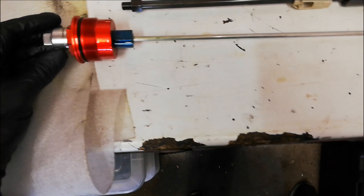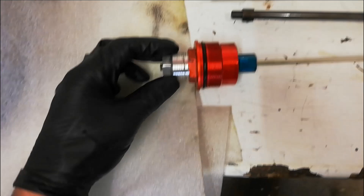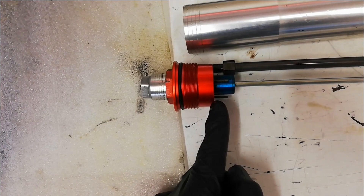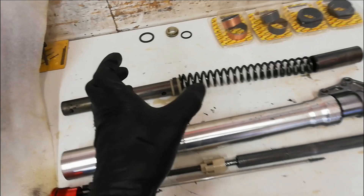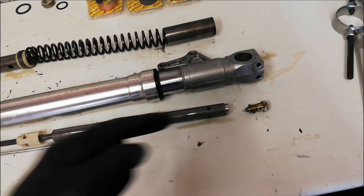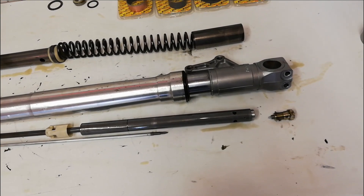These cartridges are actually peened together, not screwed together, so I'm not going to take them apart - that's a task for another day. The other interesting bit of adjustment is the preload adjuster. The preload adjuster has little metal pins sticking out. If I screw this in, it pushes the pins out and they push on the top of the spacer, which compresses the spring - that's the basics of preload. Rebound adjustment restricts how much oil is going through one side of the cartridge piston, and the compression adjuster restricts oil flow through the bypass on the compression stroke. Basics - easy-ish.